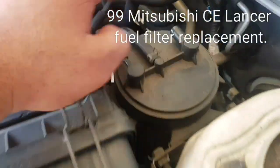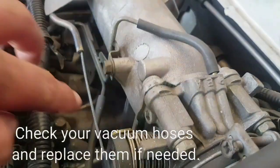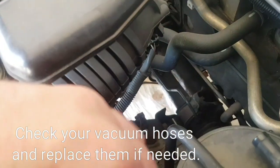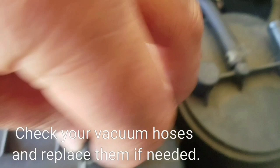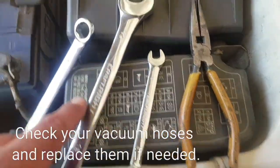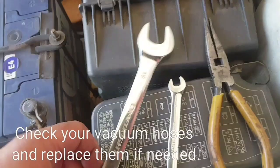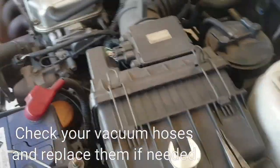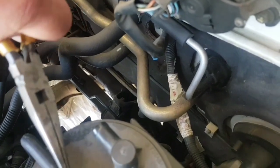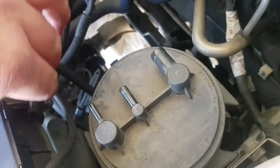To make it easier, charcoal canister out. I'm trying to find where that goes — okay, that goes into your inlet manifold, so that's this one here. I'll put it somewhere where we won't lose it. Tools you're going to need: long nose pliers, 8 mil, 19 mil, 14 mil. The 14 is going to be for the bottom line, your 19 is for your top line. Let's give this a go — taking your long nose pliers, we'll take this hose clamp up and move it back, move that line.